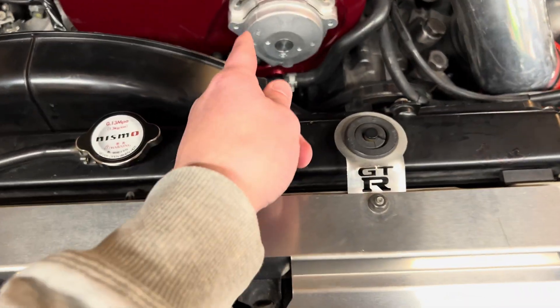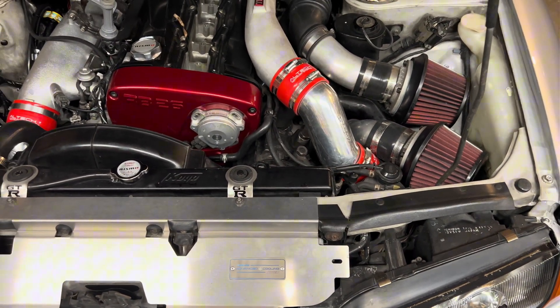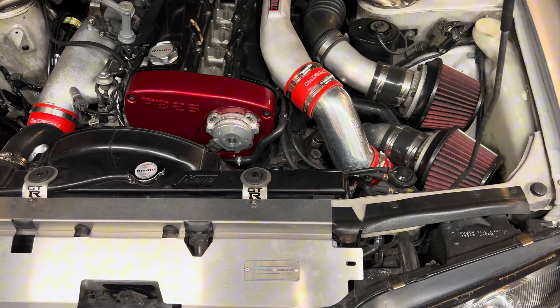Get your 10 millimeters and put them back in these three holes and get reconnected to your Haltech. The torque spec for the three bolts on the cam sensor is 12 to 15 foot-pounds — I'm going to go right in the middle, 13 to 14 foot-pounds. I've got my torque wrench out and I'm going to torque them down to spec.